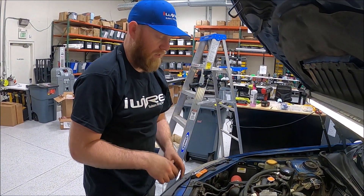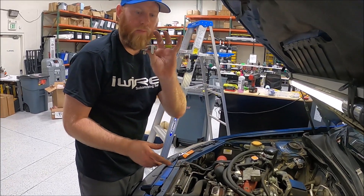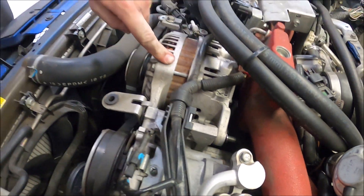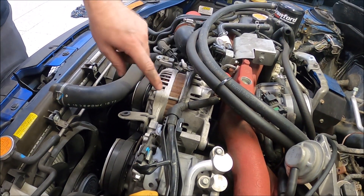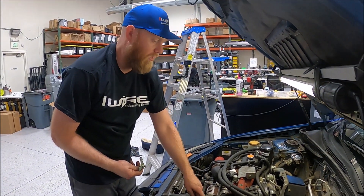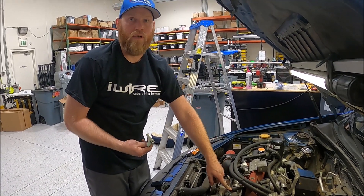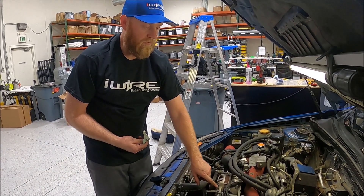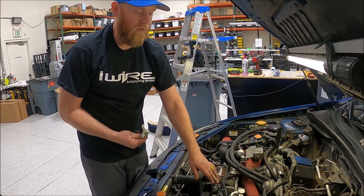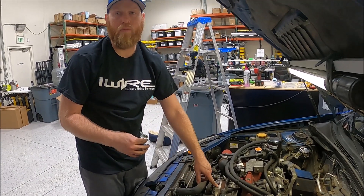The second spot, really important, is the bracket for the alternator. We took off the back plate so we can sandwich it directly on the alternator bracket. The alternator grounds on the housing, so if you've painted this or it wasn't making good contact with ground, you're going to have all sorts of alternator issues and you can even burn up the cables. So if you ever decide to powder coat or paint the brackets, make sure that where the brackets are hitting metal is sanded off, or else you're going to have big problems with your alternator.